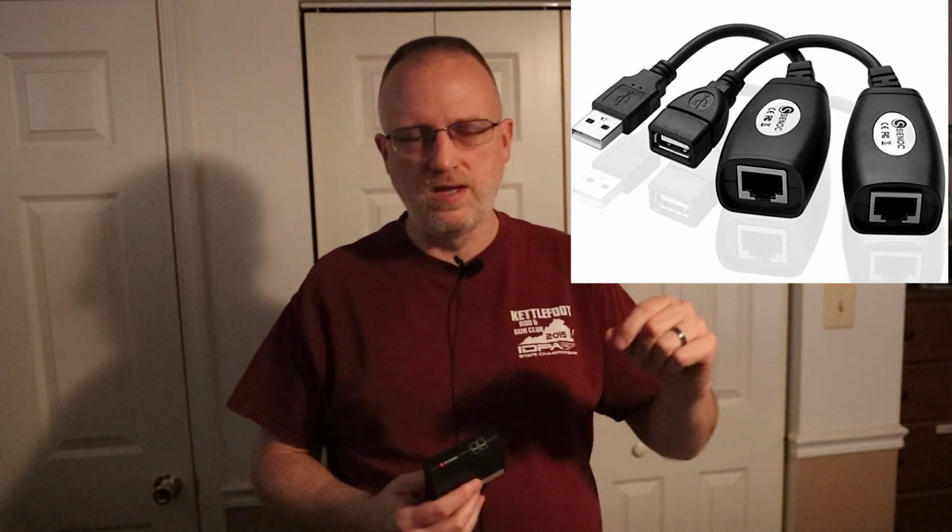In earlier videos, you might have seen that I had a little USB cable with an RJ45 port on the end, and then another one out there, and then from there I had to go into an actual USB hub. That one didn't work so well because it used the power from the USB port on the laptop to power the remote end out at the telescope, and it just would not stay stable. The USB hub out at the telescope on this AV Access brand is powered, and I have had little to no issues with it.